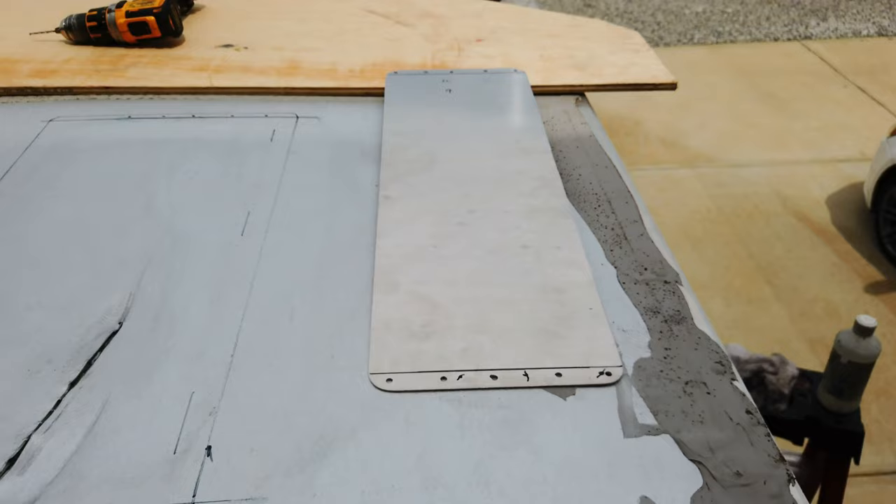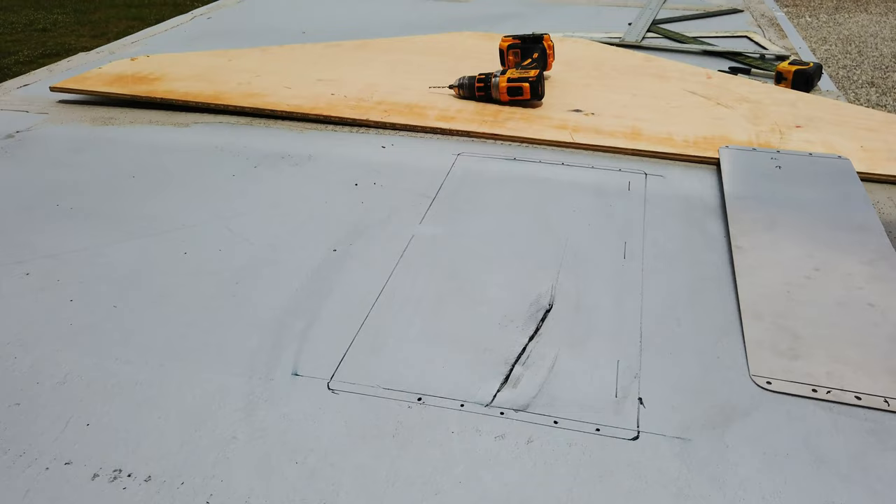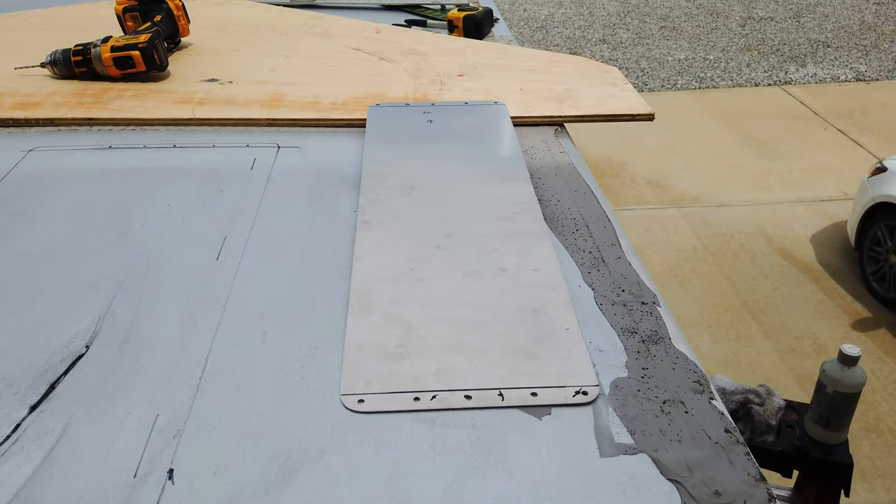There's a little tear mark in the roof of the trailer. I made a doubler on the inside — that's the big outline, and it goes from roof truss to roof truss. This is going to be the patch for the top. Going to put the seal tape underneath it and then screw it down. Pop rivet both edges with washers on the inside, and then come back over the outside perimeter with the sealant.